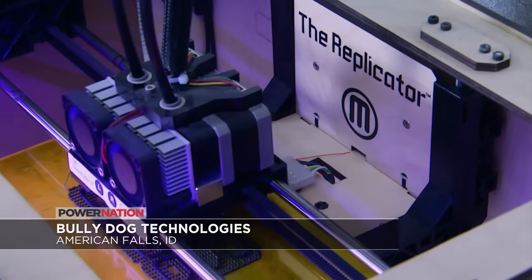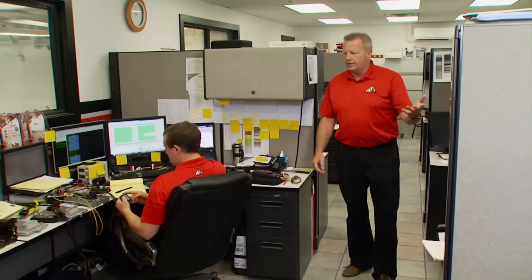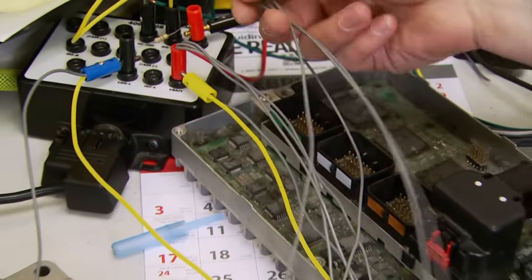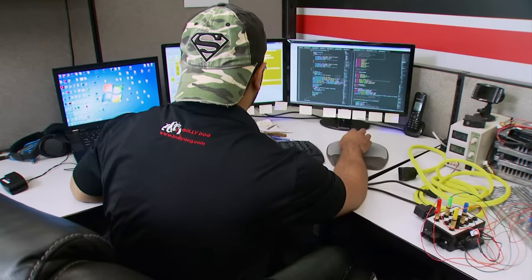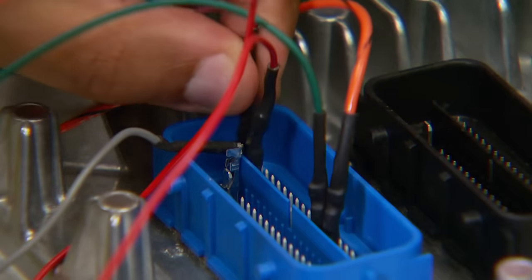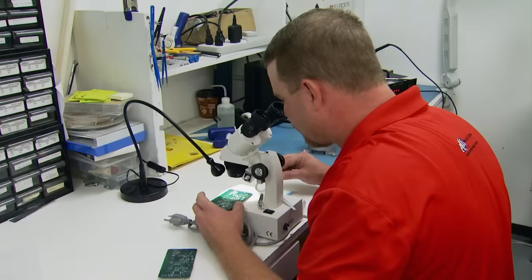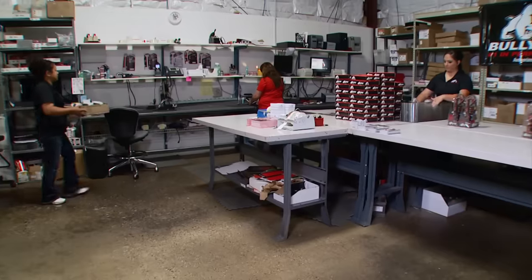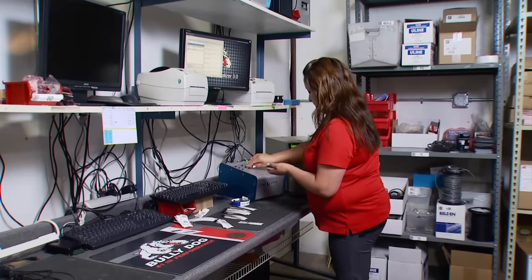Today, high-tech engineering is the core of the business. It takes a lot of time and effort to get into vehicles, and the engineering team is key to everything they do. It takes years to develop a tuner — factory modules are literally cracked open and probed, mapping hundreds of factory functions, from air and fuel management to transmission controls to even when the headlights shut off. From there, engineers write new code to improve on OEM parameters. They do the R&D, build the boards, do the board layouts, build the first few boards, and then use a contract manufacturer once the product is perfected. All programming of hardware is done in-house with their own software.